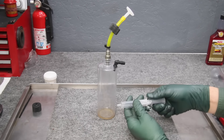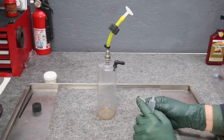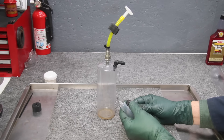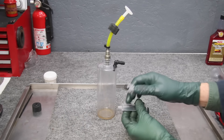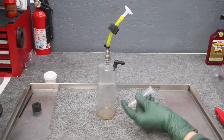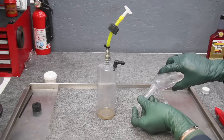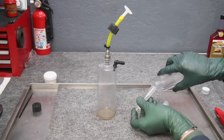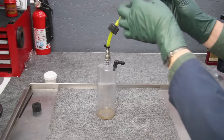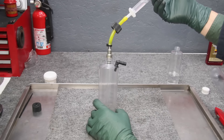Notice what I've done with the curved tip syringe — I've wrapped some saran wrap around the rubber plunger. The reason is if the rubber plunger comes in contact with lacquer thinner, fuel injector cleaner, or any other harsh chemical, it's going to swell up and won't fit inside the syringe housing. So I protect it by covering it with saran wrap and throw it away after each use. I'll put some paint thinner in here now — once the plunger is in it won't leak because it holds pressure — and you can watch it flow through the injector.